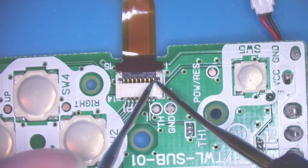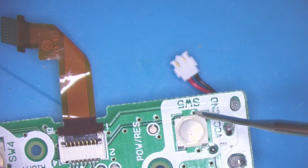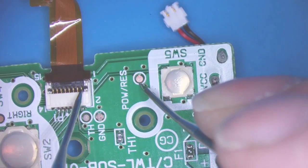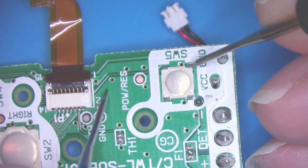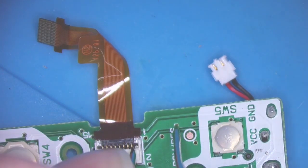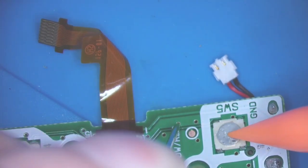I wonder if one of these switches could be jammed on. I've got a power reset here — that could be the reset pin, and then it goes to this point. There's a top button I thought I'd checked before. Is that connected? Yes, it runs up here. The top part of the power switch connects to this pin — I'll call that pin 1. The bottom part must be ground. If I put my meter on pin 1 and one of the grounded wires, I should get continuity — and I don't. The switch seems intermittent.